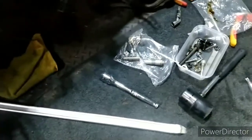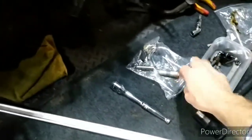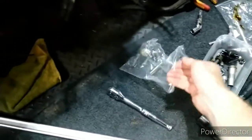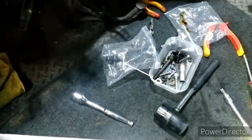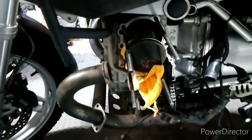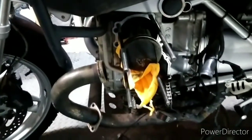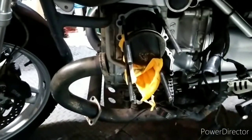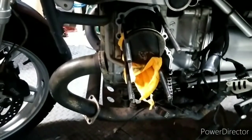Another little tip for reassembly - everything to do with the cylinder casing, I'm keeping separated from the cylinder head, so those are kept apart. I'm going to completely stuff all of those holes with clean rag so there is no possibility of anything going inside that casing. I've just got a little bit of rag there supporting the piston and conrod just so that they don't touch the casing and mark it. Yeah, that's all gone pretty well actually - I'm very happy with that.